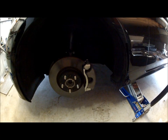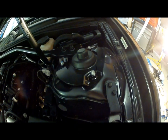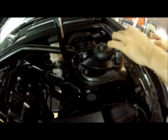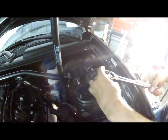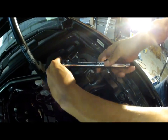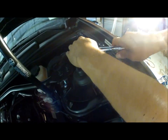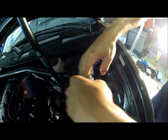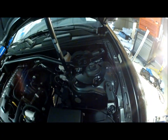Once you have the wheels off, it's basically a very easy install. First, you're going to start off by removing the three bolts for your strut tower — this one, this one, and this one. These are 14 millimeters. You're not going to remove them all the way; you're going to leave them loose. That way, when you remove the bottom portion of the coilover, the coilover just doesn't fall to the ground.